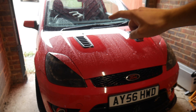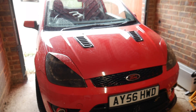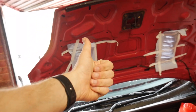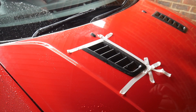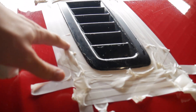The first thing we need to do is mask off underneath the vent so we don't get any spray on the engine or components down there, then dry off this area and mask all around here so we don't get any overspray. I just realized I've masked this off underneath and I need to wet sand it first - dumbass. My plan is to get tape right underneath there because when I'm sanding the edges, I want to sand the tape rather than the paint on the bonnet.